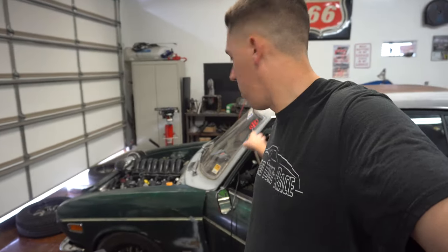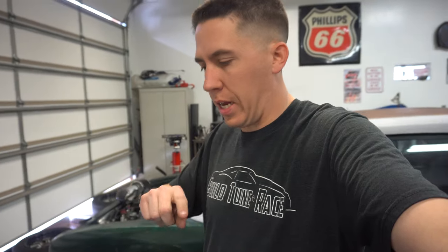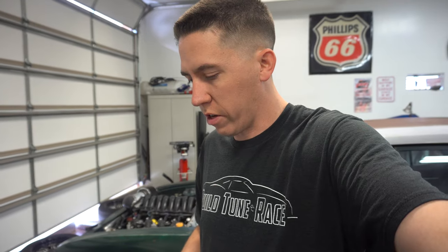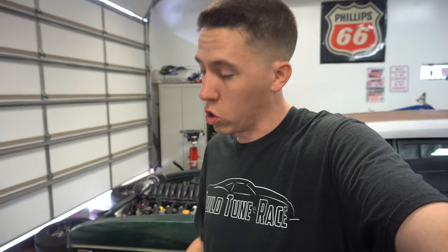All right, everyone, so we're gonna skip the ramp test with the auto and it wanting to shift. I got it to lock in gear there, but there are things with converters and the transmissions where it won't let it flash up, and if it can't get that, it'll drag the motor down. So we'll come back, I'll do a ramp. I did one down on their dyno in a stick car, and it holds it at speed and then takes off with a converter. It's like trying to lock the converter, and Clyde's a pain anyway because of the style of transmission that it has and the lack of control I have over that transmission. So it gives me something to play with and learn too as we go.